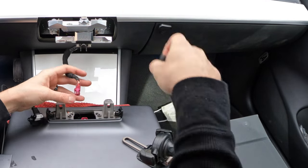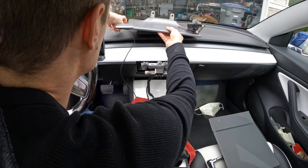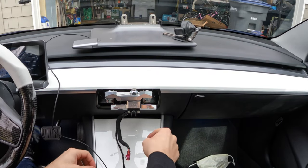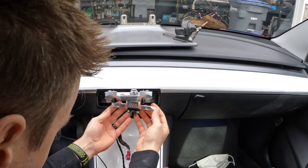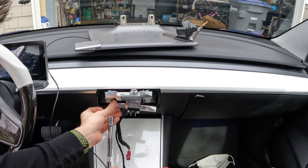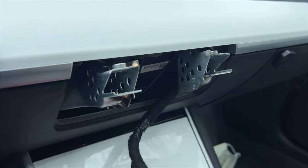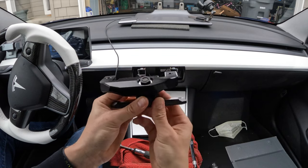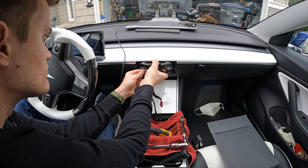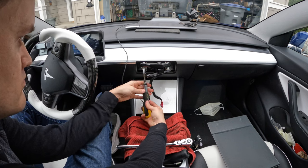With the needle-nose pliers it comes out very quickly. They also provide a foam pad to put the screen on while you're working, so you can set it up on your dash. However, I didn't notice until the video that the screen was actually sliding down towards me — when I came back from the garage it was resting on the mount. So definitely put it far enough back so that doesn't happen. Once you remove your screen, you then take the Clutch Tech mount and install it by just pushing it right into those two slots. From there, you install the two original screws back into it, mounting it in place. Make sure you get them nice and tight because this is what's going to be holding your screen to your car.